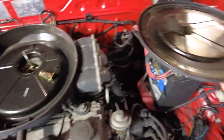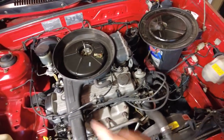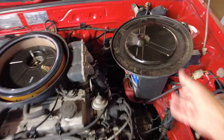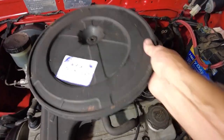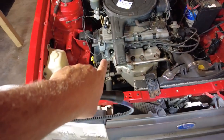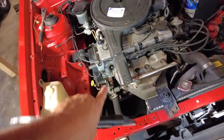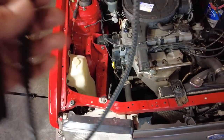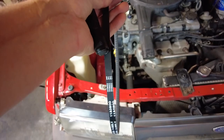Let's see if we can do something else. Time for the filter and then plugs - that's a drop-in filter. I tried the spark plugs next and they're too big - just slightly bigger than they should be based on the spark plug socket. So now I've got to go find a socket that fits.